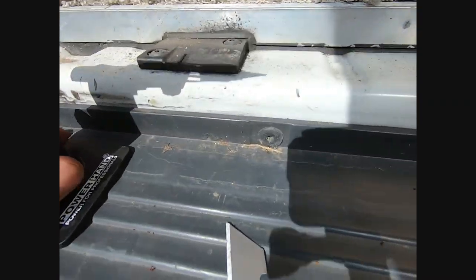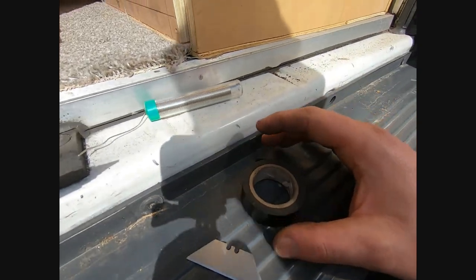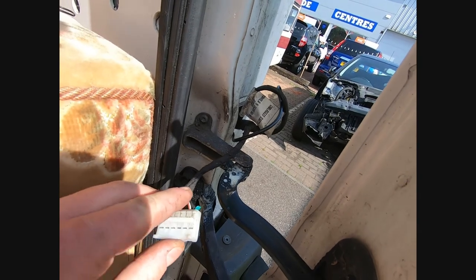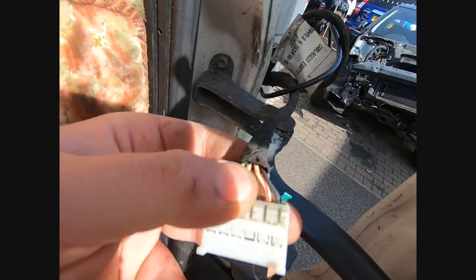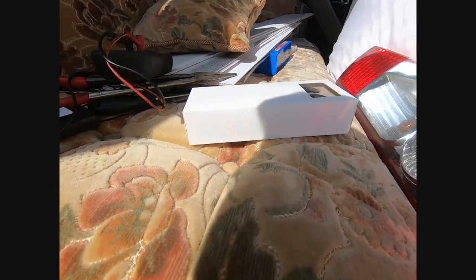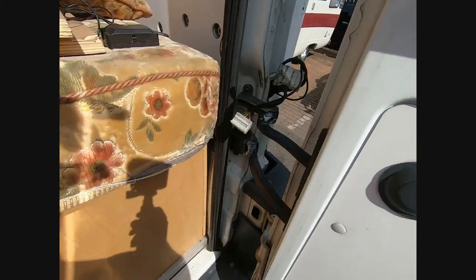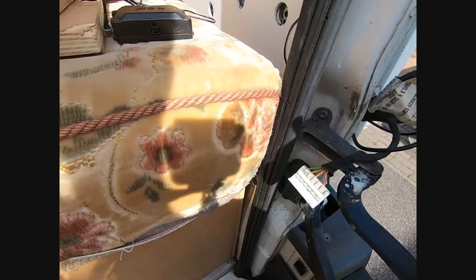I've got my soldering iron and a little blade — I'll be careful with that due to an injury yesterday, which was actually from a rusty wheel arch repair on the Jag. I also have insulation tape and solder. I'm going to carefully cut back the insulation and strip some coating off the yellow, red and white wire. I'll unplug it, then solder the red wire from the new module onto that red and white wire for our positive. For the ground, we'll just join the black one straight onto the old plug since we know it's a good earth.